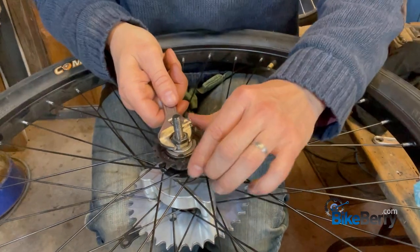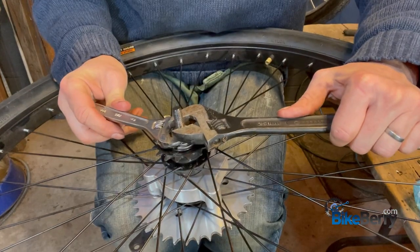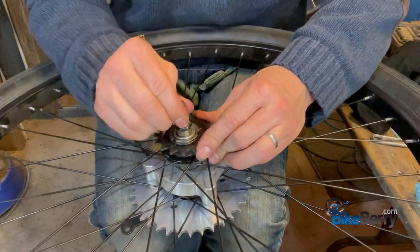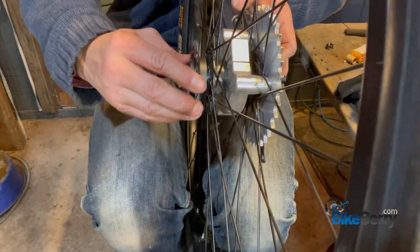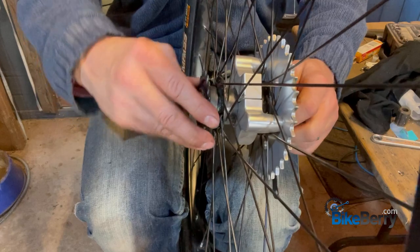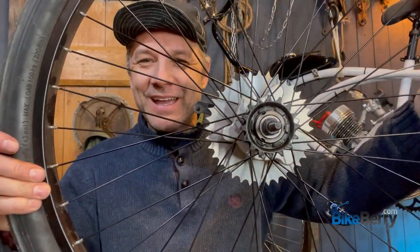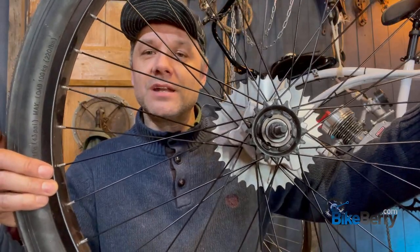See, way too tight. Get them tight on there — there we go, bolt at once is the way to go, it just moved much nicer. I feel that now — it's smooth feeling. There's really no slop in the whole mechanism. Works as it should. So now we have an appropriately tight axle that works perfectly. It spins, locks, stops — perfect. You can see how quick I adjusted that, even after I messed it up and put the bearing in there upside down. I got a new one, put it in there the correct way, and then showed you how to tighten it up pretty quickly.